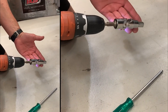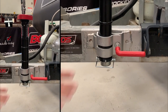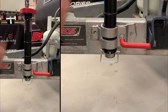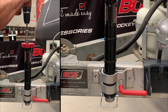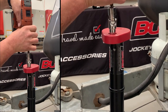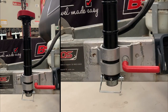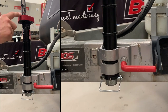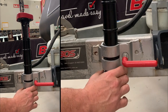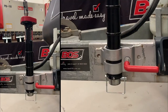Change direction to clockwise — which is for up — drawback pin coming out. I don't need to put a screwdriver in here because we're already locked with our locking system. Both hands on the drill — clutch is not strong enough to undo it, so use drill mode. Hold it, and as soon as it has enough power it will undo this. It won't spin the drill because this is the weakest part that's going to undo and extend out. That's how you unlock the locked jockey unit.